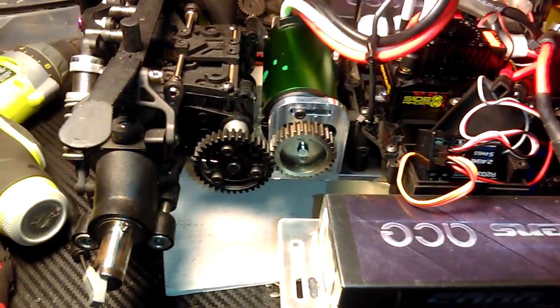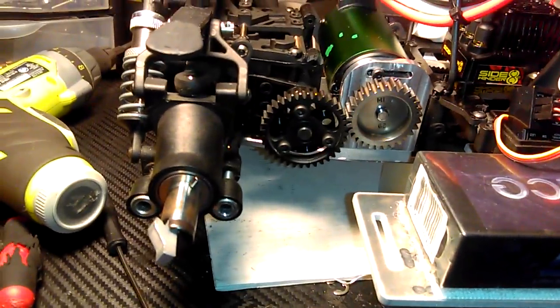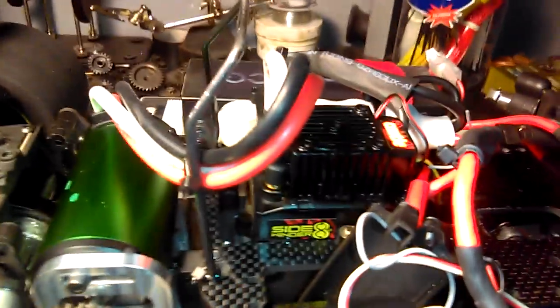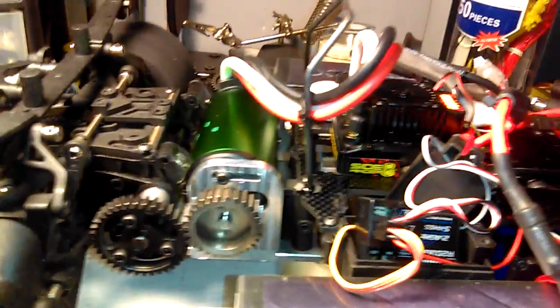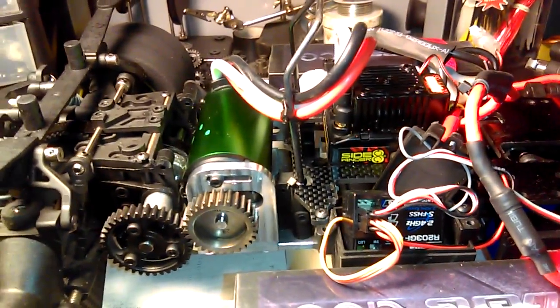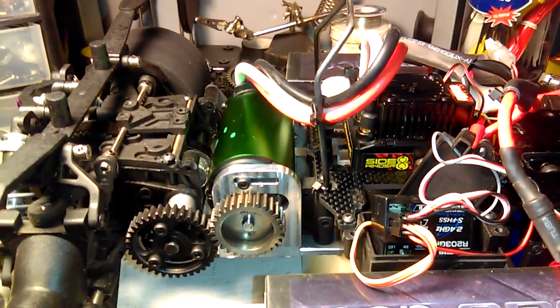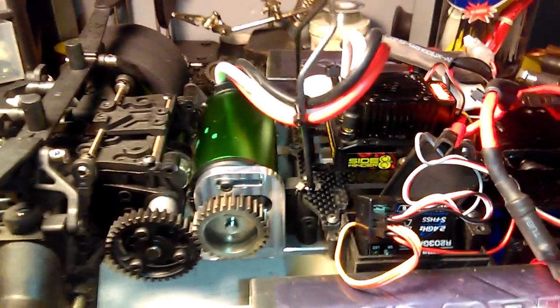What's good YouTubers? This is your boy Tad Money coming back at you. I got the gears changed up again. I went back to 38/29. I hooked the Sidewinder 8 ESC back up to the laptop and I turned down my brakes a little bit — actually I put them back to default which is 50 — and turned up my start and punch just a little bit. And this is where I'm at.